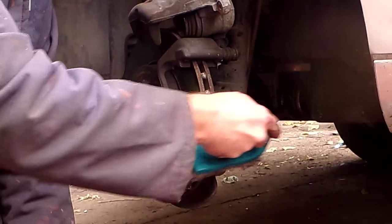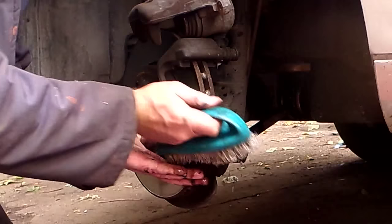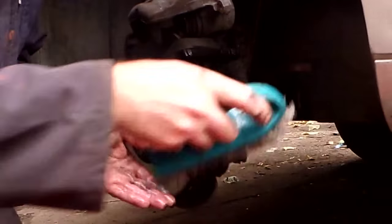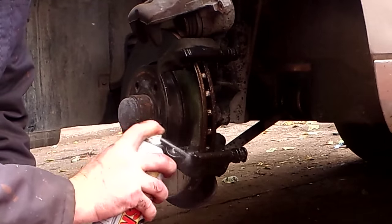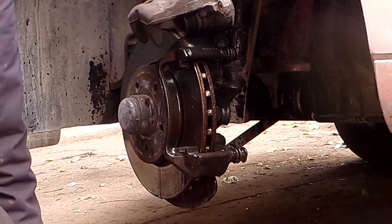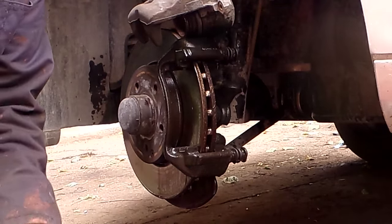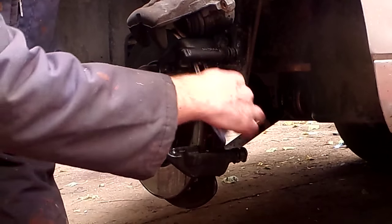Clean off where the clips mount — that's a little dirty. The bottom one is always going to be a lot dirtier because that's where stuff falls down onto the grease and dirt. I'm just going to blast that off with some brake cleaner. The degreaser does not evaporate and leave no traces, but brake cleaner does. Whenever you see brake cleaner on sale, buy five or six cans — it's like two or three dollars a can instead of the regular six, seven, eight bucks. One brake job on the front and you're going to use a lot of it.